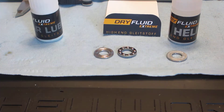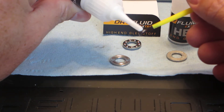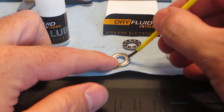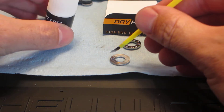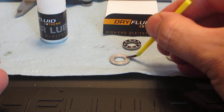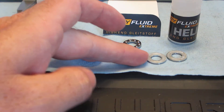What you're going to do is set that aside and let it dry for about 10 minutes. I'm going to do the other side of the thrust bearing — just put a little bit into the bristles and brush it around, get a nice even coating. You don't want any silver showing, but you don't need to flood it either. A very thin application of this works just fine. That one's done.